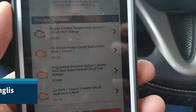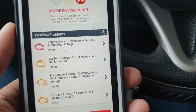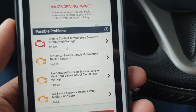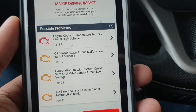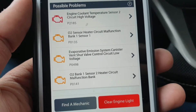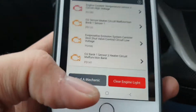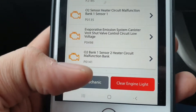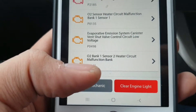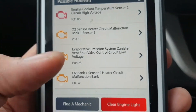There was also an engine coolant temperature sensor circuit high voltage code. I replaced the engine coolant temperature sensor from the top, but the code was still there — it didn't do anything. Then I thought maybe it's the bottom one, so I decided to replace the O2 sensor Bank 1 Sensor 2, which had a broken wire connected to the sensor.